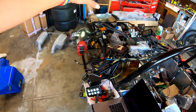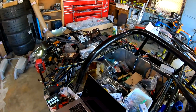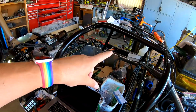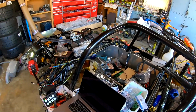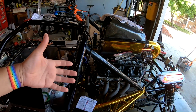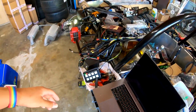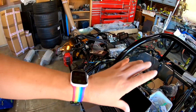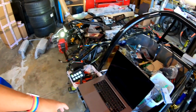So from here, this is basically everything in a running state except for the ECU. Now if I hit the button a third time, the ECU has power and the whole car is in a run state. If the starter was connected and the ECU was programmed, we could start the car from this state. Going back to our non-run mode, our accessory mode, if you will.